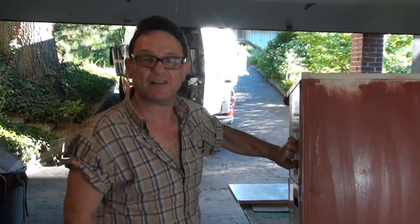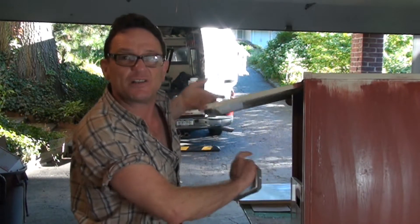If you're not that confident in your spray painting abilities, you wouldn't want to start on the most visible surface like the top of a cabinet. Maybe open the cabinet and start spraying something inside, underneath, or in the back where no one's going to see it — until you get a feel for the whole spray painting thing — then move on to the more visible surfaces.